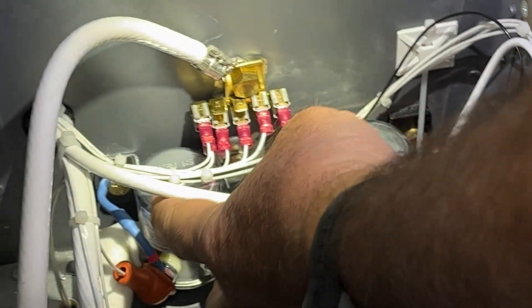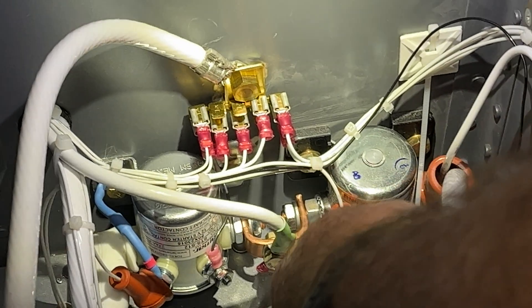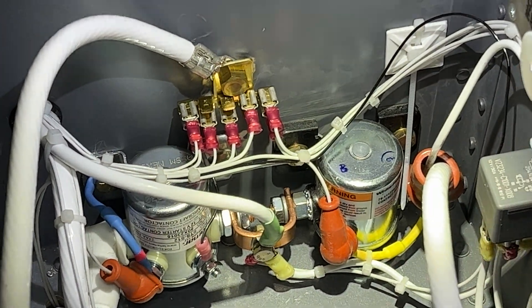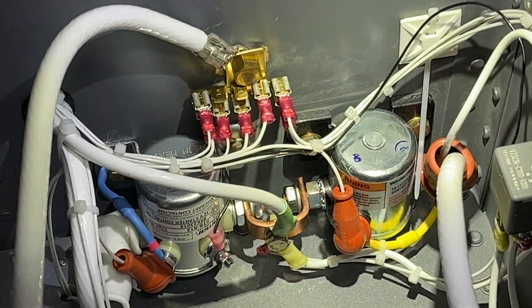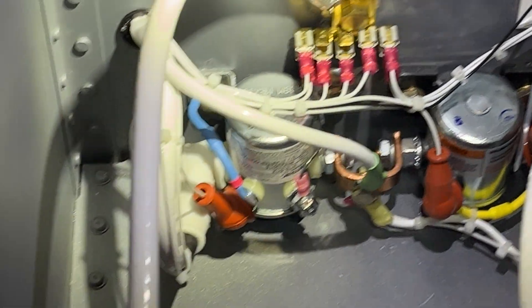The primary purpose of these diodes is to protect the switches. When the magnetic fields on these solenoids collapse, you get a large voltage spike on the circuit, and electrical switches will arc and eventually fail. You can see I put a ground bus here — this is the primary negative lead.